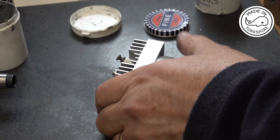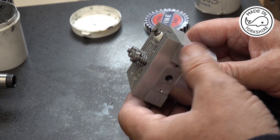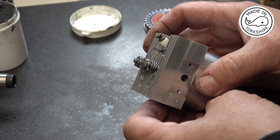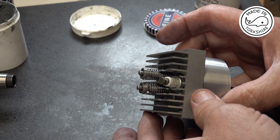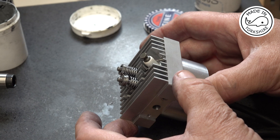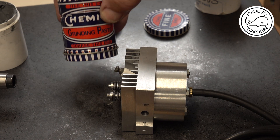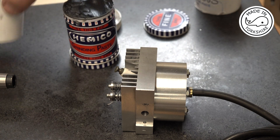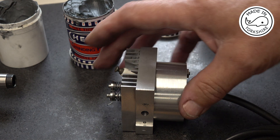This is the second head. I can't feel anything coming out of the ports. Looking good, very happy with that. I'm quite amazed really because I only spent maybe two minutes on each valve — maybe a minute using the coarse paste, then the fine paste, and then a minute using the 500 grit. I never used the 1000 grit. Come out really well, very happy with those.